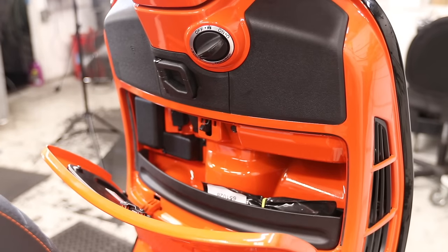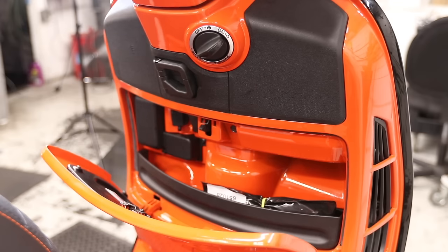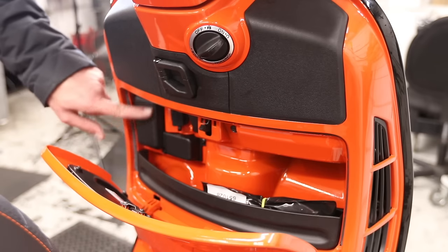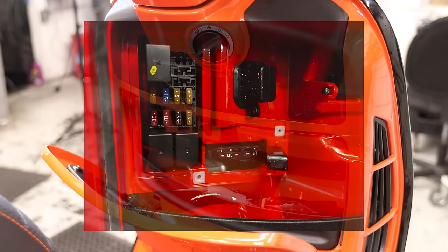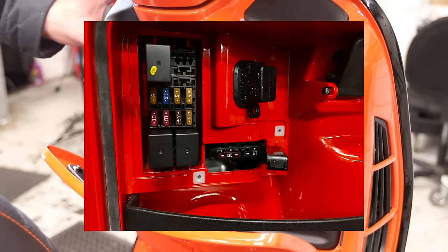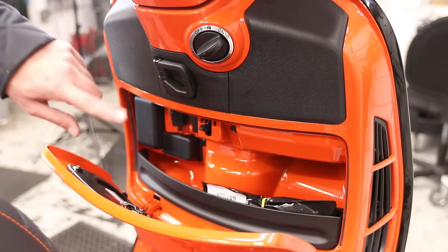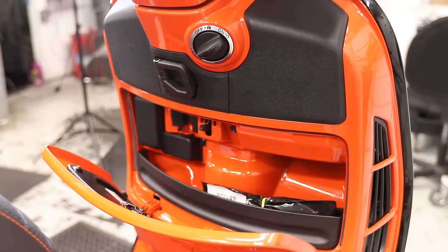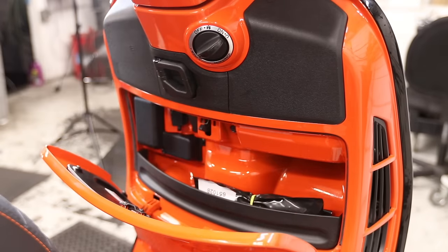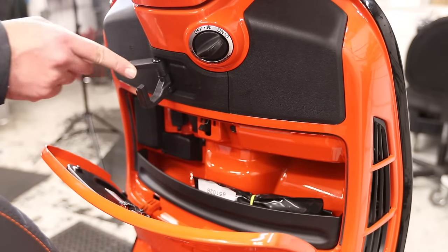You might as well just use the switch up on the handlebar. Next to that you have your USB port — still the same as you're used to on other GTSs. Down here is kind of new: the fuse bank has been accessible from inside the glove box for a little while now, but we pulled this off earlier and you can actually get to some relays in there now too, which is cool because your local shop or you, if you're a home mechanic, don't have to pull the entire glove box off anymore to get to those relays. They are now behind just two Torx screws, included in your toolkit. Also on the glove box is a newly designed bag hook — it is no longer a circle; it's now a square.